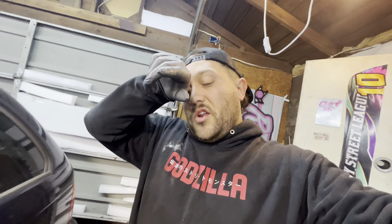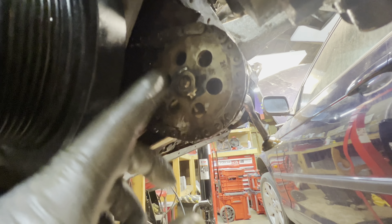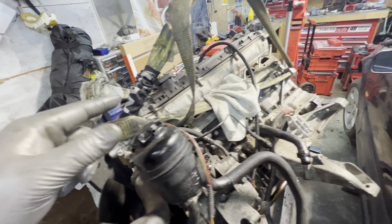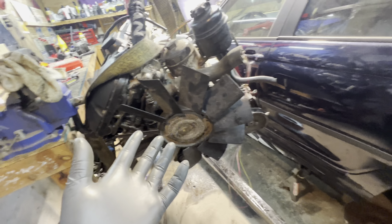I showed you guys me about to try putting in the old three liter I bought from Marketplace - it was junk. I leak-down tested it and every hole but one was complete leakage - bad head gasket for sure. So I got impatient and decided to buy a motor. I overpaid at a junkyard - paid $850 for this motor. I've already started stripping it down. I tack-welded the oil pump sprocket to the gear because these like to spin the nuts off - pretty much a necessity on three liters if you're going to drift them. Got the oil pump and pickup back on, put the pan back on to seal the bottom. Now I've got to make a run to the junkyard to get the drive-by-wire pedal and some wiring connectors for the MS42 to MS43 conversion.